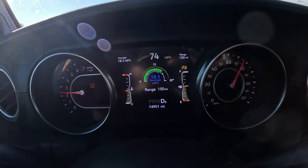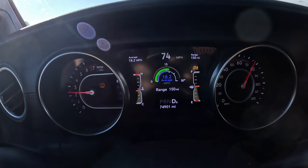Even on the highway, I'm getting about 17 and a half miles per gallon when we're going to and from places on long trips. Here locally, I'm getting about 14 to 15 miles per gallon, which actually isn't too bad. Getting almost 18 miles per gallon on 37s — in my book, that's a win. We did go with the Yukon kit, and there's a lot of debate on whether those gears are still good or if they have manufacturer's defects or if there's counterfeits. I'm at about 13,000 miles since we did the re-gear and I haven't had any problems. We love the 5.13s and we definitely recommend them.